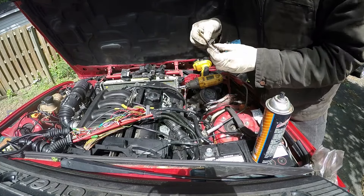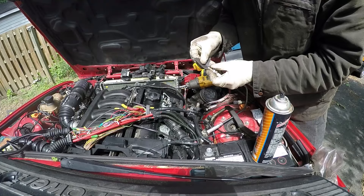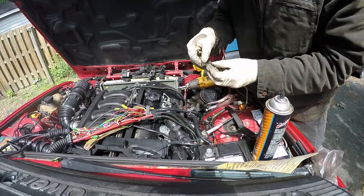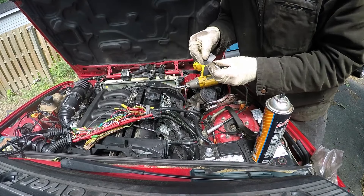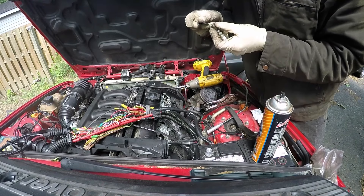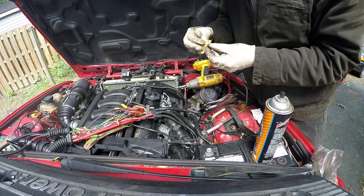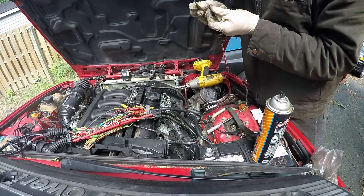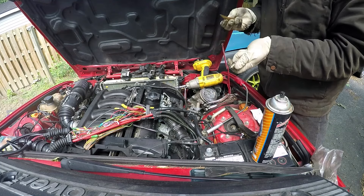The problem with these platinum fours is that they get crap in between — I don't know what they're called, anodes, cathode, something like that. Normally you just take a little bit of 400 grit sandpaper and lightly sand them down so they don't have any more carbon deposits on them, and that's usually good enough. I just want to figure out whether or not the spark plugs are the issue — if they are we'll replace them, if not there's no harm in cleaning them.